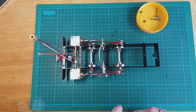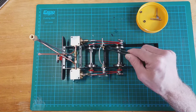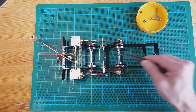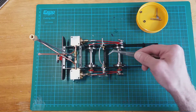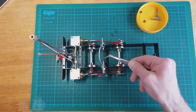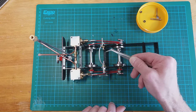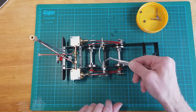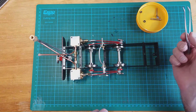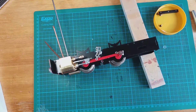What he suggested is to remove the lower chassis frame spacer, and then you've got a bit of room from the underside just to line the washer up with the pin, and then perhaps with a pair of pliers give it a tap to get it started on the end of the pin. I'm going to have a go at that and see if that works.